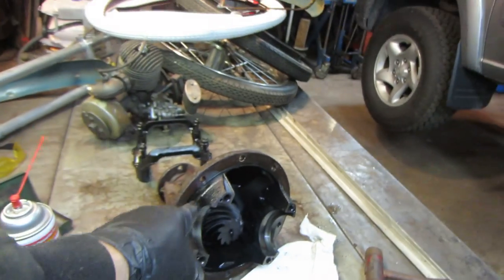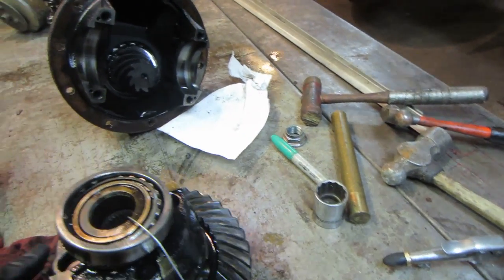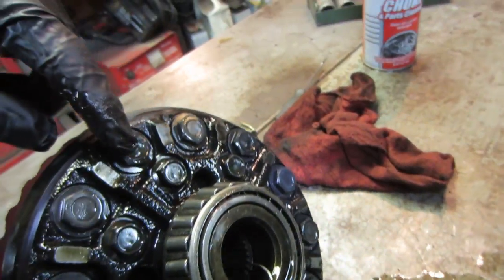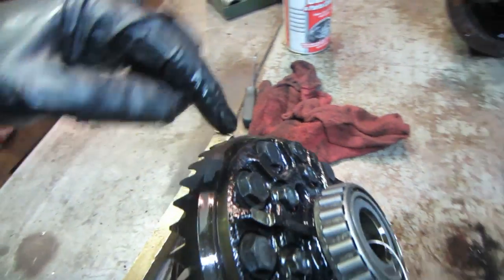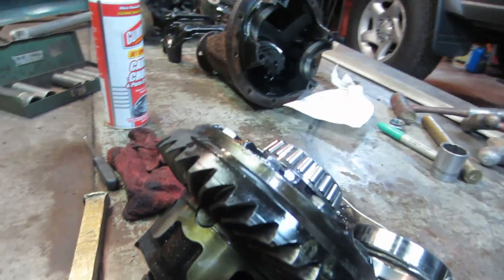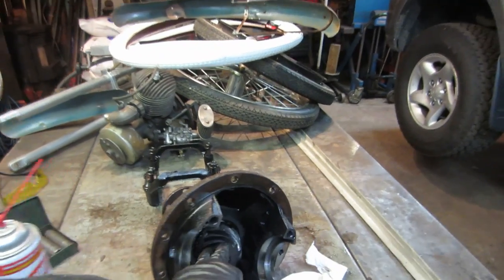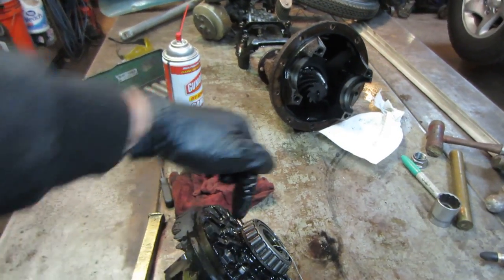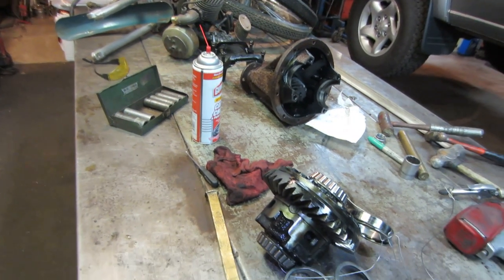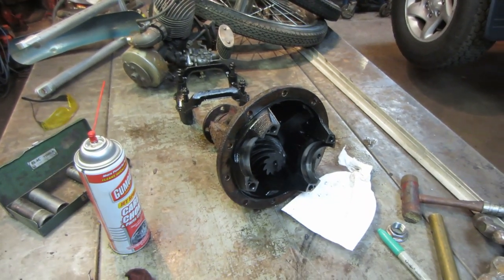I think what I'm going to do is continue to take that apart, see if the case is damaged or not. Like I said, I think I could take the ring gear off — that might be okay. The other bolts still hold the clutch pack together. Leave the driveshaft off, so essentially nothing's spinning in there anymore — just the two axles coming in. The only thing that really needs to stay wet is those two bearings. We'll see — let me get that apart and make a better decision from there.